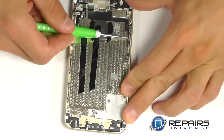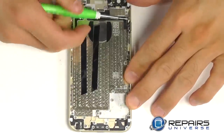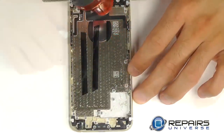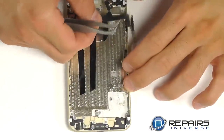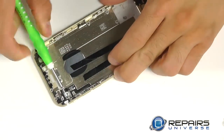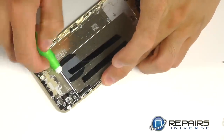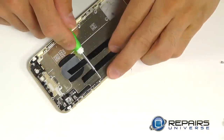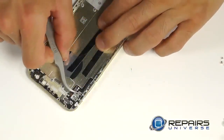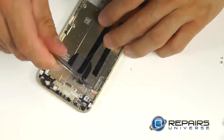Let's bring our attention to the power button and camera flash assembly. We're going to use three Phillips screws into the side of the phone. Again, we'll use heat to soften up the adhesive to make peeling up the ribbon cable a little bit easier. Our volume buttons are going to be last — again, three Phillips screws in the side of the phone — and carefully peel up the ribbon cable from the adhesive. That's a complete teardown for the iPhone 6, and we'll show you how to go ahead and reassemble it.